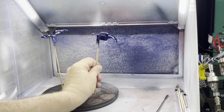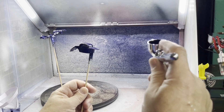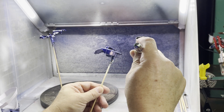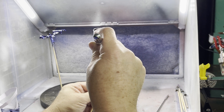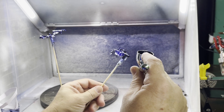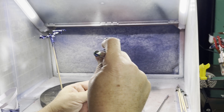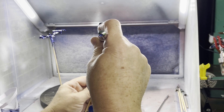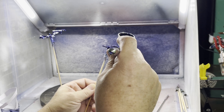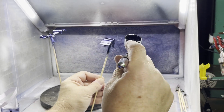Could use one more coat to get a little bit darker, but look at that - that's looking really good. It's a custom, personal preference - if you want to stop at two coats you stop at two coats, you want to go to four coats go to four. Just realize on your candies the more coats you put on, the darker it's going to get. We're going to go a little bit heavier on this coat - we don't want it running or dripping, but we want a wet coat on here. After that I'm going to let it dry.